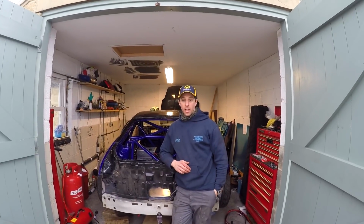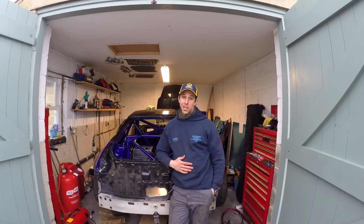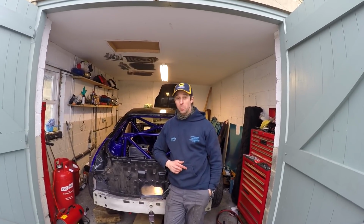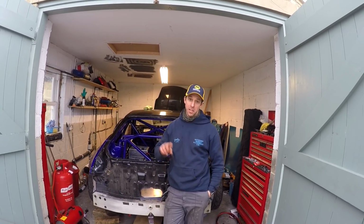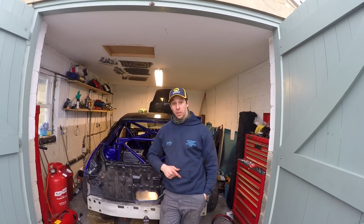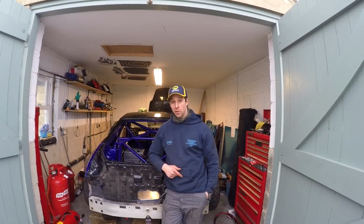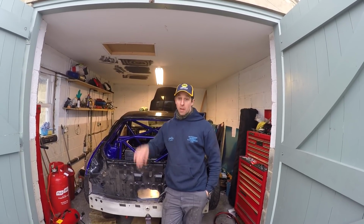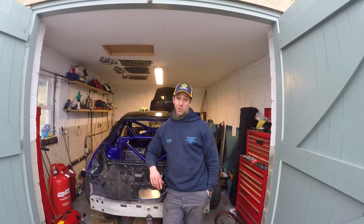So it's the end of Sunday. You probably haven't seen a great deal of chatting from me today. After we talked about the fuel system, we had quite a few wiring issues. It turns out we had one of the injector wires and one of the coil wires the wrong way round, which then caused us about 3 hours worth of wire troubleshooting. But I can say she's back up and running, and we are actually going to get it to Fab Shop in the morning for those exhaust systems.